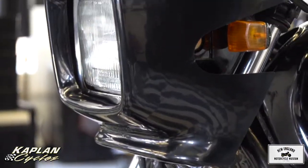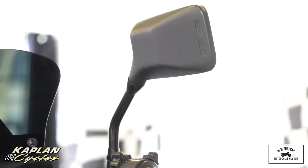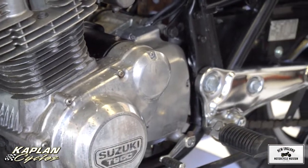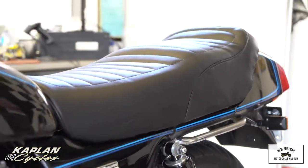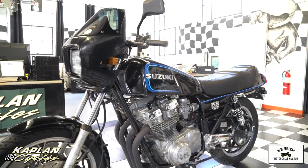So new battery cables, all the wires in the entire bike have been gone through, all the connections have been cleaned. We removed and properly cleaned the fuse panel connections, and we replaced the five glass fuses. There wasn't anything wrong with them, but we put brand new ones on to make sure that the contacts are perfect, and cleaned the contacts while it was apart, and then tested the resistance. So on the electrical, Mark is not only a guru with carburetors, he's fantastic at electrical work.